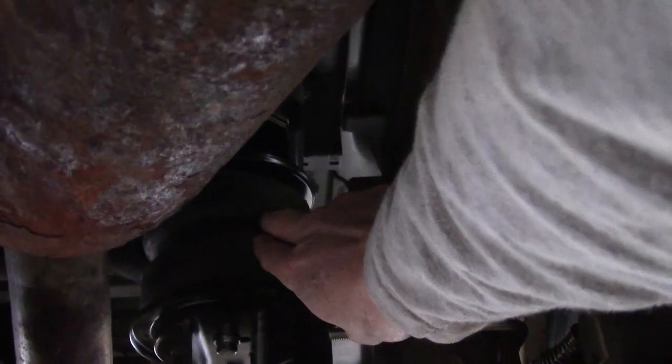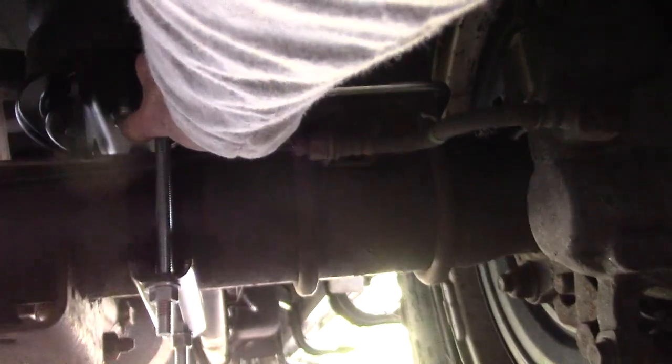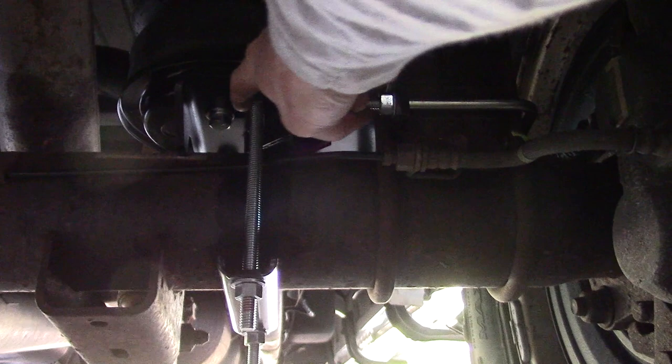And the same thing on the U-bolts, after tightening this U-bolt up. And amazingly enough, I've had to do very little adjustment. I've got really perpendicular alignment with the pad, so it worked out really well. I was really happy. Again, this is where you'll need the 14 millimeter ratcheting wrench. You can kind of see you're space limited, and basically your wrench can only move that far. So, highly recommend it.